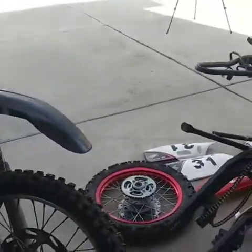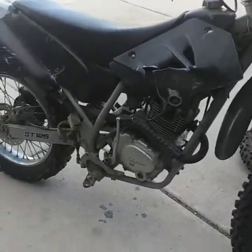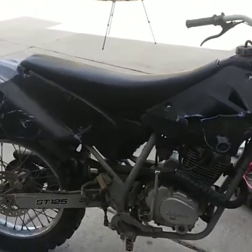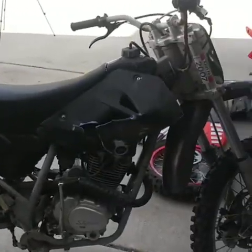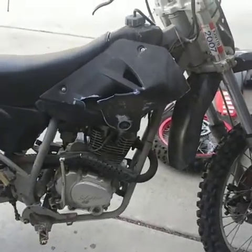We're gonna check on for spark on them. Well, at least just this one right now. Got to see where this one is going with it. But check for spark, take the carb off, clean it up, and then we'll go from there, see if we can get it going. And we'll share some videos on these because we're excited.